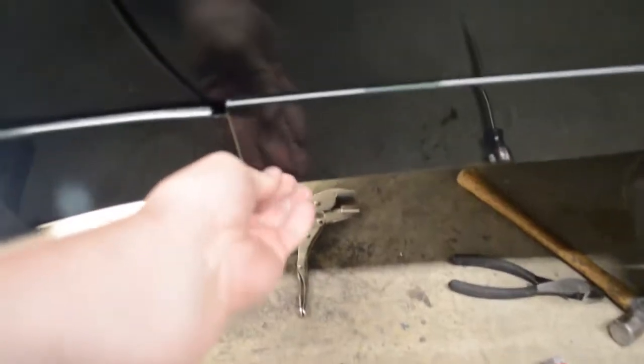I think I found the problem. The side skirts are all put back together, but see how this is still loose? I can push it back and it'll be fine. I had to bend back my pinch weld — I don't know if I did it or someone else did, but my pinch weld was really bent. I've straightened it out. I'm going to try sanding it a little bit; if not I'll just touch it up with some spray paint so it doesn't rust. I still need to find a point to put a screw in so it'll stay. Everything's working fine — put my blood, sweat, and tears into this car. Got my arm a little bit, but you know, still working on it.